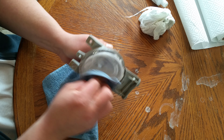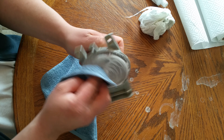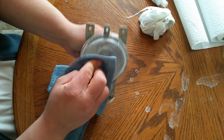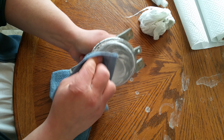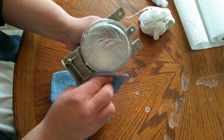Believe it or not, I've heard of people doing the same thing for DVDs and CDs, though I'd rather use an actual system for that. This outer side here I'm actually not too concerned about because it sits within the bumper, so the only thing I'm really concerned about is getting this front piece. There's no light coming out of the side here because it's blocked by the fascia. After about a minute or so you'll notice it gets more difficult to polish — that means it's drying out and the toothpaste is actually working its way into the lens itself.